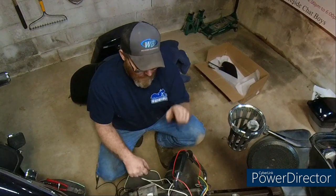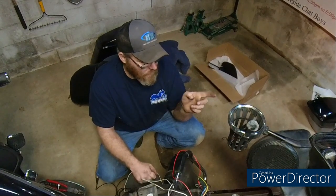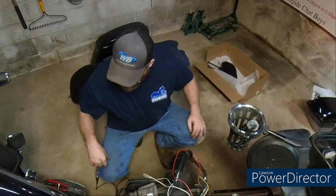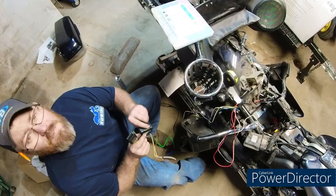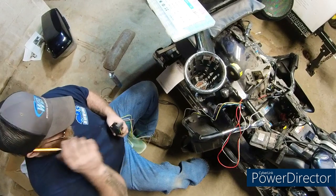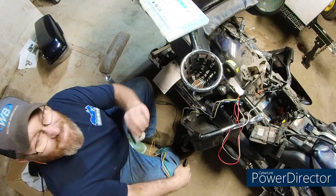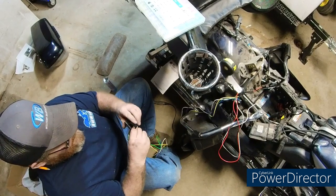I'm going to have to test all this again, write it down, and get my plug and check. I've gone through and written down all my color codes: green is the run, yellow is the right turn - boy, that throws me off - brown is the left turn, blue is brake, white is ground. Of course, five wires. However, when you get to the trailer side of things: white is ground, brown is the marker, yellow is left turn, green is right turn, and blue is brake.